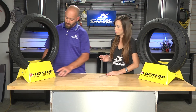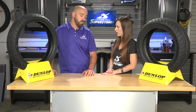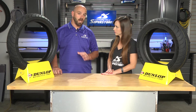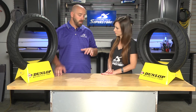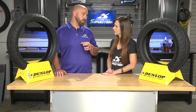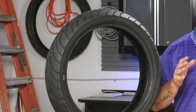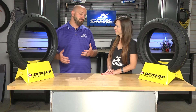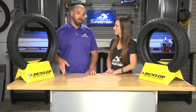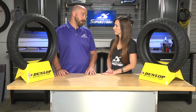So in addition to the wet weather riding, a lot of our riders are riding high miles. What have they done with these tires to address the high mileage riding? A big one to note is that Dunlop is multi-tread in all of the rear tires on the Elite Four. What that is — you're going to have a denser compound in the center and a softer compound on the shoulders. That denser compound is going to get you the mileage that you're looking for. They are claiming better mileage than the Elite Three, and they've also said that this tire is capable of going coast to coast in the U.S. six times. That was done on a third-party test on U.S. roads and it was done on a Goldwing. Mileage is kind of subjective, but as long as you keep up with your air pressure, these should be the highest mileage tire on the market today.